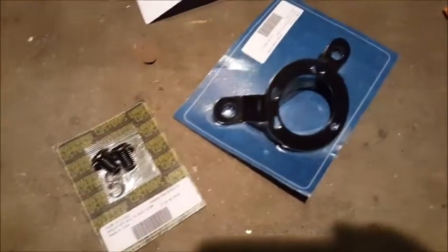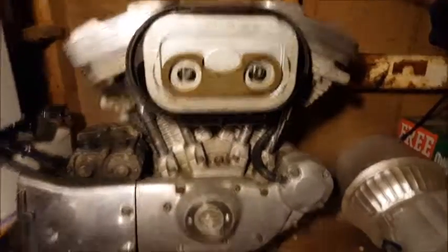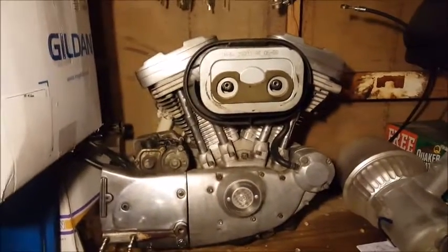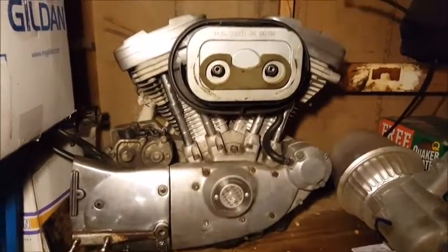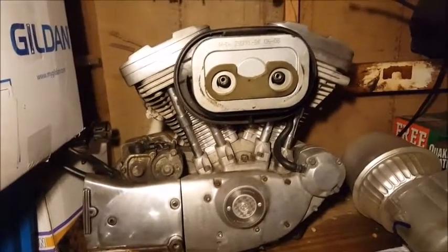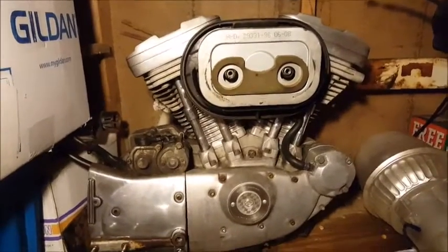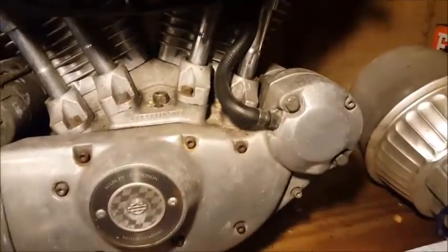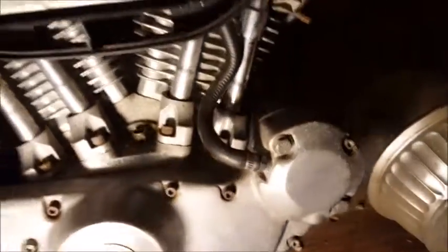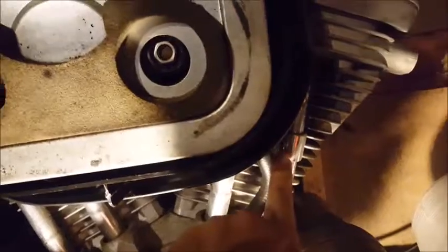But that's what I've got. Here's the old motor, and I sure feel bad every time I look at it — it's like breaking up with an old girlfriend. There's not one bolt or one bearing or any part inside or out on this motor that has not passed through my hands. I know it very well. This is what I was talking about with the breather. This is the old style breather, this is an 86 to 90 era motor. This is where the crankcase would breathe — right here — then the hose would go up here and recirculate through the motor.